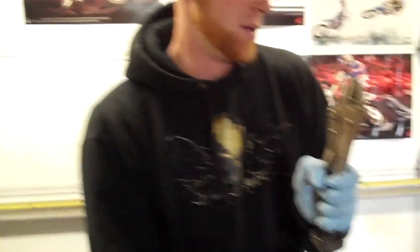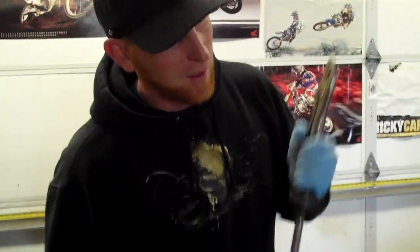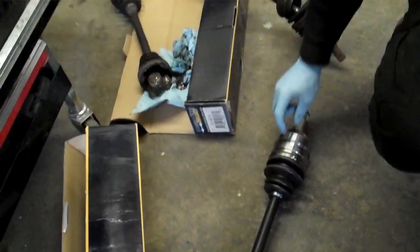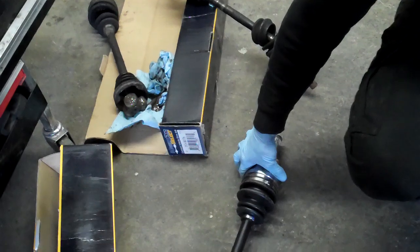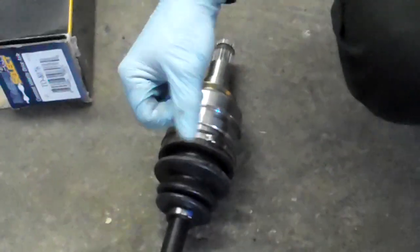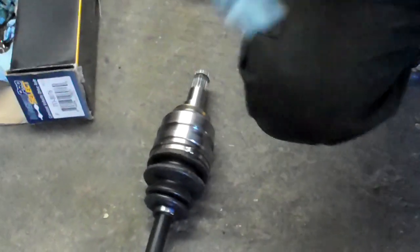Now to the subject matter. We've got a car with a CV axle that won't come out. We pried and pried and it just won't come out. It's a Toyota one where it's kind of recessed in here, and it's got three points where you have a slot like this. There's a special tool that grabs the axle and knocks it out, but we don't have that tool — we have this one.